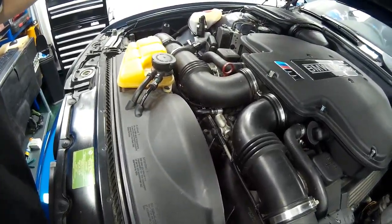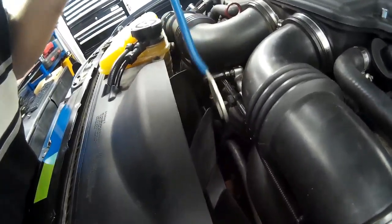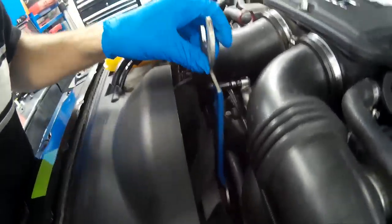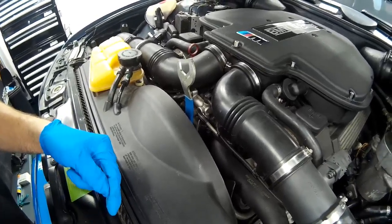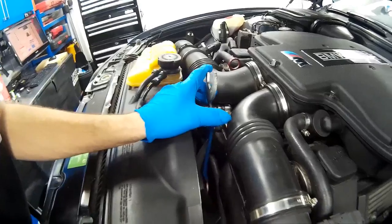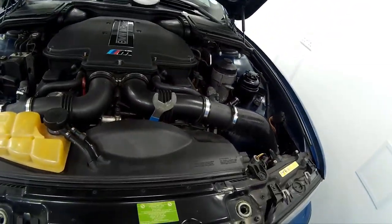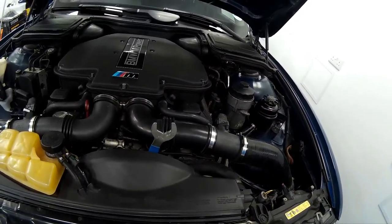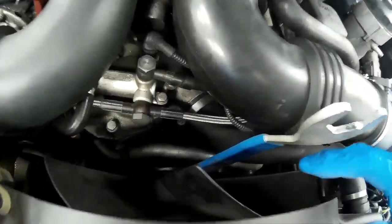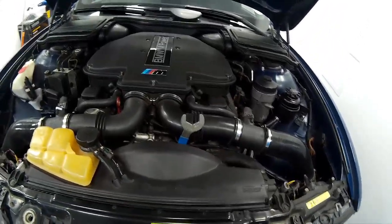Next up we need to remove the viscous fan assembly. To do that use a 32mm viscous fan spanner — it is a left-hand thread, so as you are looking at the car you want to turn it in the direction that the engine rotates: towards the driver's side in America, towards the passenger side in the UK. Once you've done that you'll be able to remove the viscous fan — it might take a bit of cracking to get it off. I use a big rubber mallet to hit the spanner and shock the nut loose. You can get a proper tool which also locks onto the water pump pulley bolts and allows you to use opposing torque for pushing and pulling to free it off.